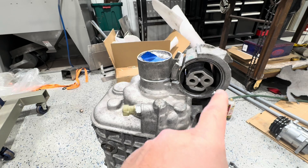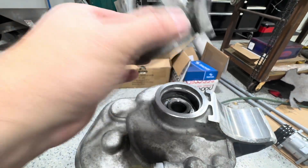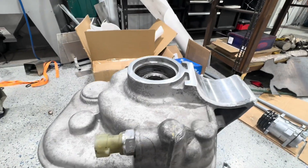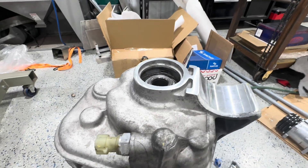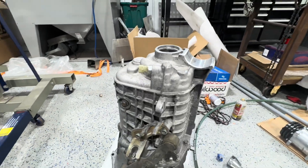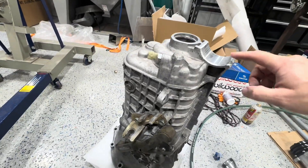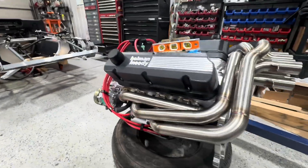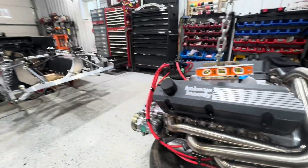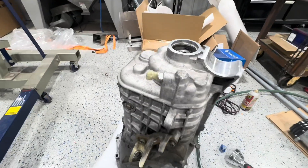Here's our before and after. I cut the transmission rubber mount off, which makes it look like that, then bore scoped the inside and chopped that off too. Gets me almost three inches of extra space to be able to mount this. Used a flap disc to grind it down nice, stuffed some rags in there to keep debris out. So that makes it shorter because it mounts on the back of the 302 small block Ford, and this gets mounted upside down — this used to be the bottom in the 911. Mounted upside down and right in here: 302, transaxle on the back, slips right in there, and your drive shafts come out at each side.